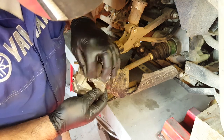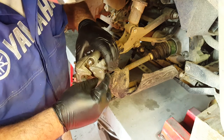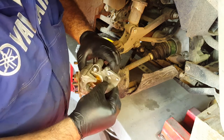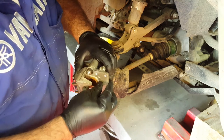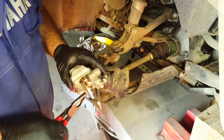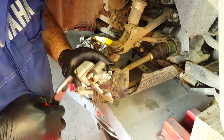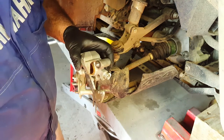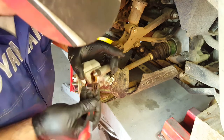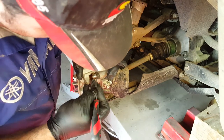Now, just remember where the washers are — there's a little metal washer that goes on first — and we can now remove what we call the pad carrier. We've got two sliding elements: one here which is pretty good with plenty of grease left in it, and then this other one which can't be removed this way — it has to go out of the back of the caliper. We need to remove that to put fresh grease on it. We've got to push that back all the way through, but unfortunately the boot gets trapped, so we need to carefully flick that boot over the end of the slider without ripping it.